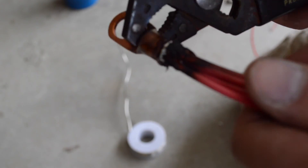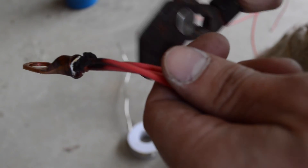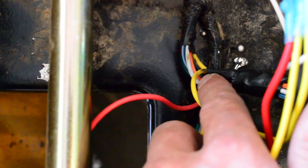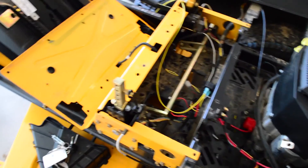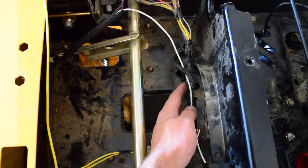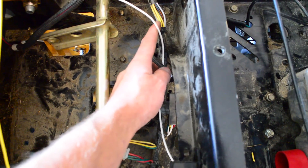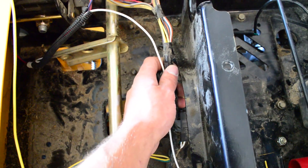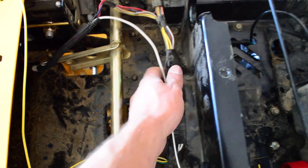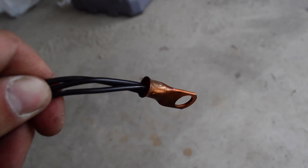You can see it's a little messy but it's strong and it's probably the best connection we'll get. We'll just take some heat shrink and slide that over there. You can see where I tapped into the safety ground shutoff - basically if the engine shuts off for any reason, so does the front headlight. Now the next thing I'm going to do is open up this harness right here and tap the wire called A1 off of the start switch. When the start switch is running that red wire is hot, so I'm going to run a fuse off of it and use that for my accessories and switch. You can also see right here that I just made my ground wires too.